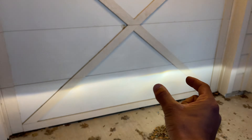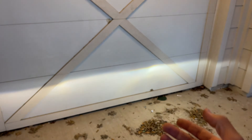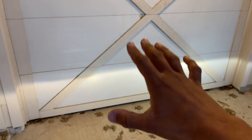We just want an even line across the top. You can see right here where the actual headlight beam is — my camera might not be able to catch it but it's right there. You can get a piece of tape just to mark it off, but I think visually just by looking at it, that's pretty good. I basically raised it up a little bit so now my beam of light should go further down the road, be a lot safer at night, and able to see more — while keeping it to where I don't blind anybody else.